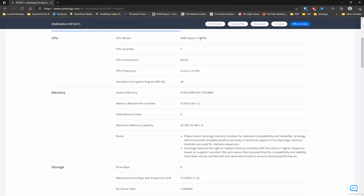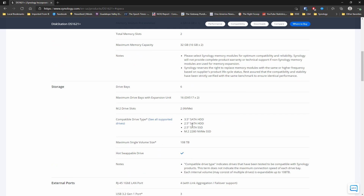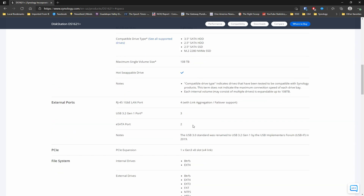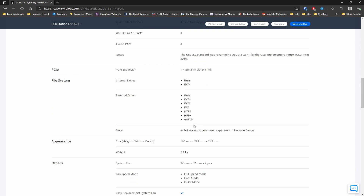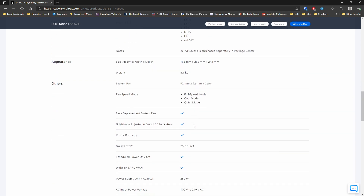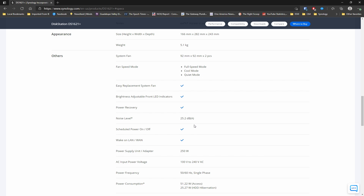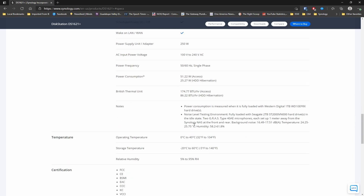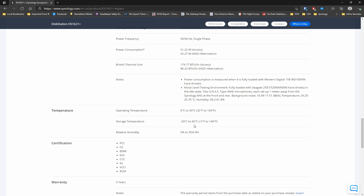The Synology is here, it's in its new home, and I'm very happy with it. It's only got four gig of RAM — you can upgrade that, I think, to 32. It has a PCIe internal card slot in it. Of course I'm going to slam a 10 gig NIC in there — that was the whole idea of getting this NAS, which was also the reason for getting the QNAP, since it had 10 gig built in.